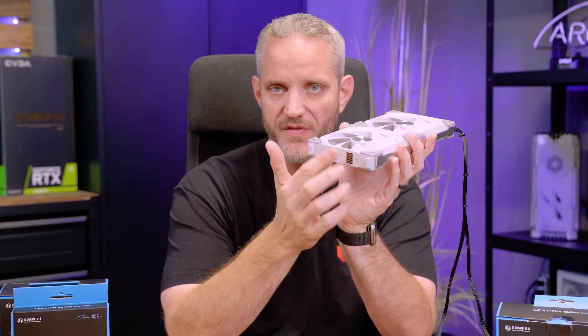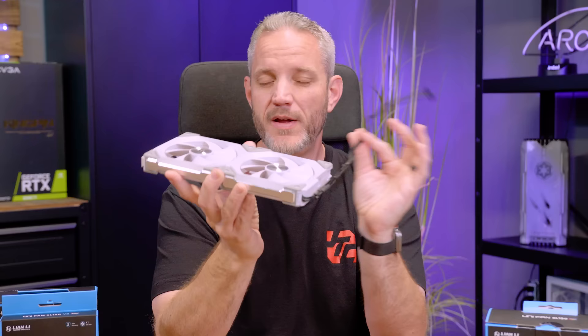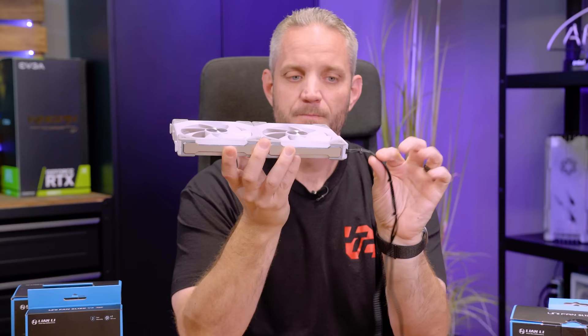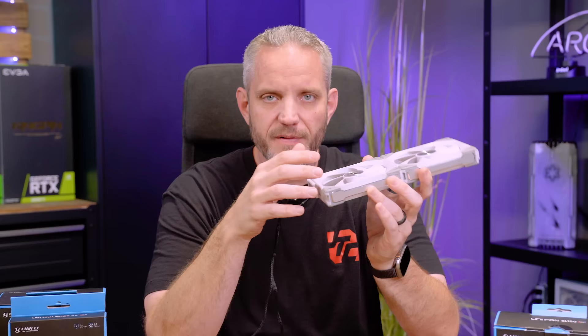It would force which way your fans had to go to be able to clear this. And the problem is sometimes this would then be facing the front of your system and you'd have to route cables back behind — and the cables are not that long to begin with. So it became a cable routing issue, and you were just really shoehorned into a certain direction. As I found with the Spectre 3 build, length was a severe problem.